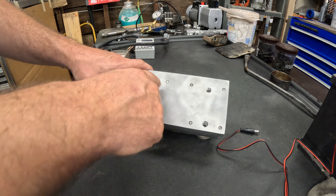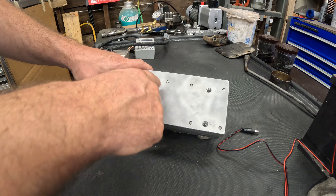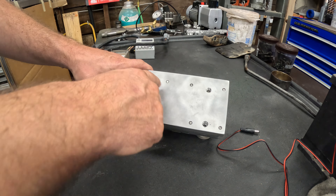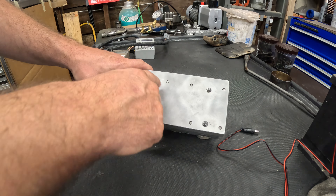I do the hold position in case I want to flush a sticky solenoid — if the ball's hanging up I can pump fluid back and forth. If I have a sticky solenoid I can try to clean it right here on the bench. If I have no luck doing that, I can get more serious: I have a plate where I can hook up a regulator and apply shop air to the inputs of all five solenoids while using the box to open and shut them. I can put pressure gauges on the other side to check for any leakage.